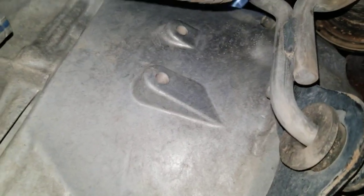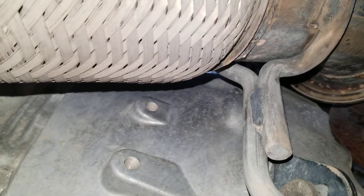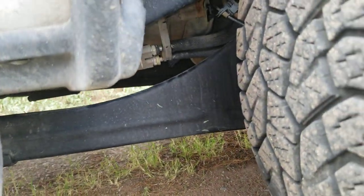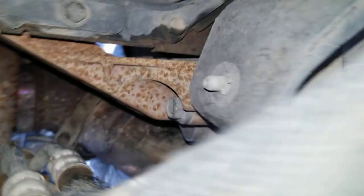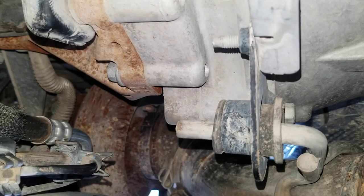What I ended up having to do is go under the truck and look up into the area where the downpipe goes up to the back of the turbo, on the back of the engine. It doesn't matter what transmission you have — there's a plate that you can take off back up in that area. There are two holes there: one allows you to remove the torque converter bolts, and the other is where you insert the barring tool.